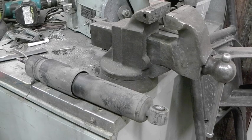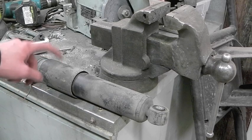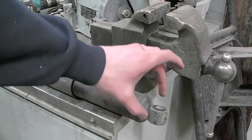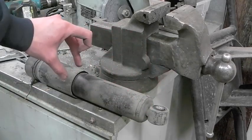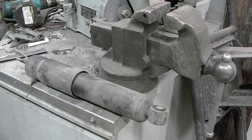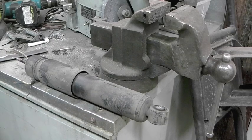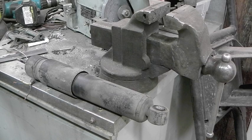So that's telling me that this is somehow changing what's inside of the shock. Your standard run-of-the-mill shock absorber — this is just a dust cover, this is where it all happens. You've got the cylinder in here and a piston that moves back and forth. That piston has holes drilled through it, and as it moves, it displaces the oil that's also in there. Smaller holes and thicker oil mean the shock is harder; larger holes and thinner oil make for a softer shock.